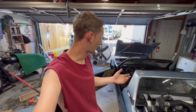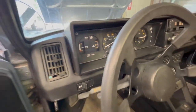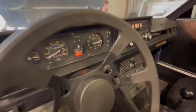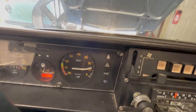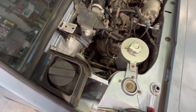All right, so this thing has been running for some time, and it still doesn't sound the best, but it's gotten some temperature in it. As you can see right there, about 150, so we're getting warm, but the good thing is we are charging, the oil pressure is good, definitely need gas, at least the warning light works, and we're sitting at about 1 bazillion RPMs according to our bent needle, so probably closer to 900, a little high. So we let this circulate a bit, we're gonna kill it, like that, and get some fans going to blow all this out. Start working on that to see if we can get it to move.